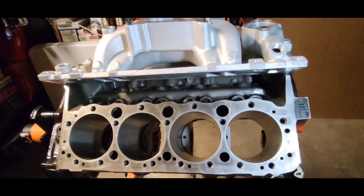Only you know your engine better than anybody else. If your mill revs 5 grand and it's out of camshaft, then you don't need studs. If you rev 7000 or higher, change over. But both applications should have a windage tray.